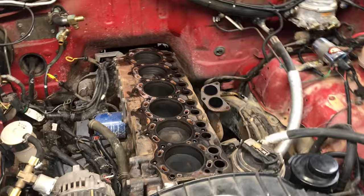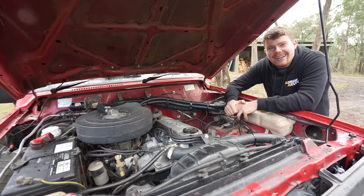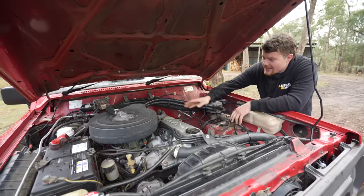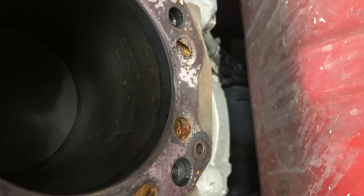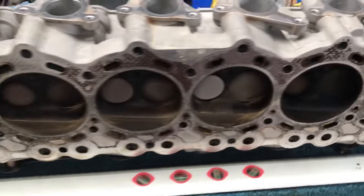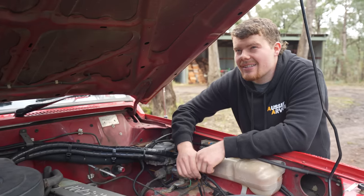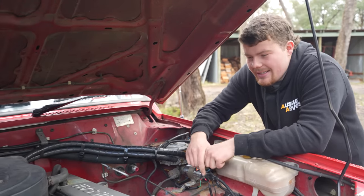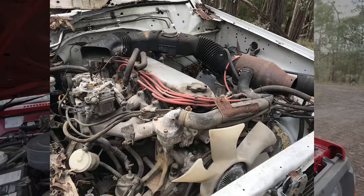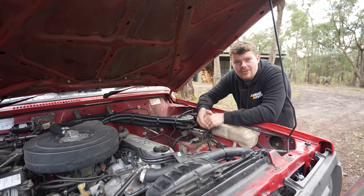That's one TB42 minus a head. Just going to clean that up and see what sort of warp it actually has. I was lucky to find where the head gasket was having an issue — right at the back of number six. The cause was almost certainly the aftermarket head that was on it. It had a Chinese reproduction head cast in 2012, which considering it had probably done under 20,000 Ks since being put on the car, really says something. So I've gone ahead and got a genuine Nissan head off another car — thanks to my mate Pete. Had it machined, valve seats, valve guides all done. Essentially a reconditioned genuine head.